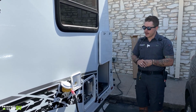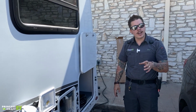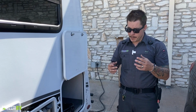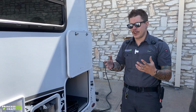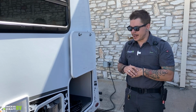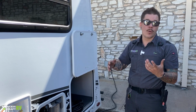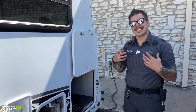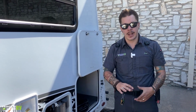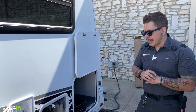Now, once we've done so, we're going to again focus on the hot side of any fixture. We're going to turn that on. Now, you're going to see a little different things here. That flow at that fixture is going to be initially very airy, very spitty, very interrupted. What it's doing is displacing the air within the unit and refilling it with water. Once that flow normalizes at the fixture, that is your indicator that you do have 6 gallons within the unit, you can go ahead and choose your source and start heating your water.